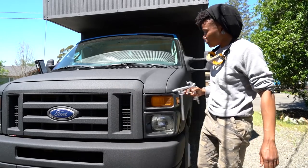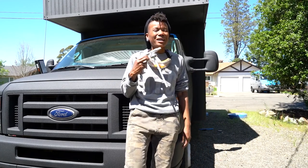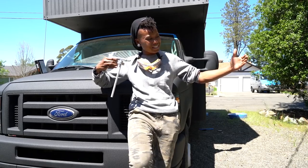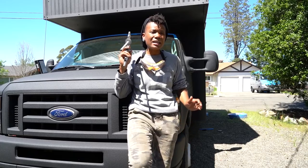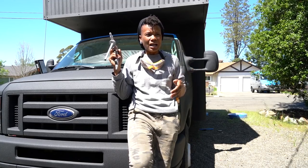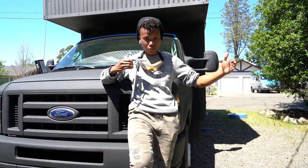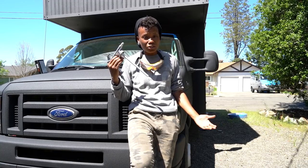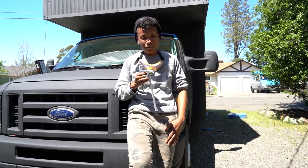So I went from one foot away from the truck to about three feet away. For my first pass at three feet, I had the gun pretty much perpendicular to the surface of the truck while spraying. I let that pass sit and dry for an hour. For my third and fourth passes, I was still set at 80 PSI and still about three feet away, but instead of spraying directly head-on perpendicular with the truck, I sprayed the paint at a 45-degree angle.